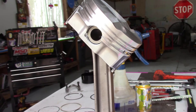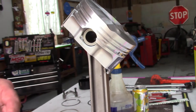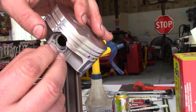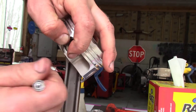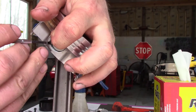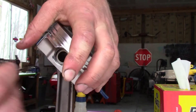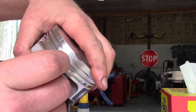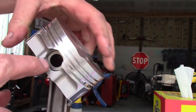We're hanging our last piston on our last rod here. I've got my little process down after muddling through seven already. For the snap rings: put it way in the back like this first, push it down with my thumb, pry up here to get it parked in the spot. Then I've got a 16mm socket that fits almost the same size as the wrist pin, give it a shove in, and she clicks right in there — see how it seated.